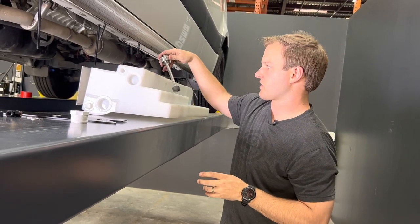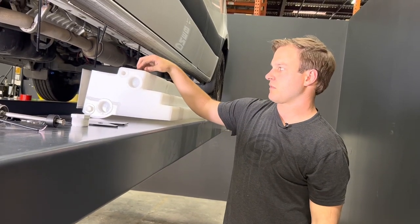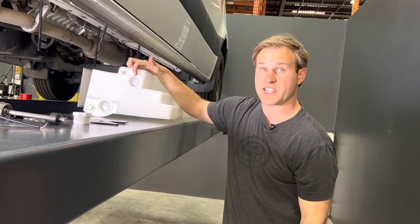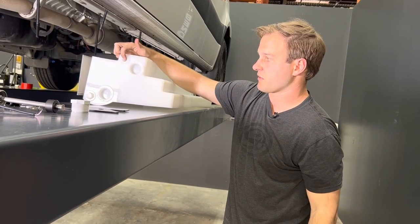The KUS sensor ends up being perfect after it's fully screwed into the tank. We have a 3/4-inch MPT on the top for your vent, so before install you want to put your 90-degree vent on there. We also have an inch and a half on the top here, and a half-inch MPT if you're using this as a waste tank and need to fill into the tank.